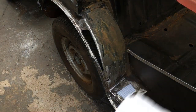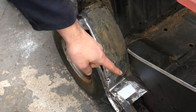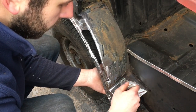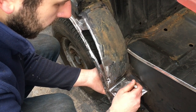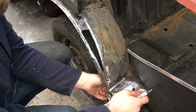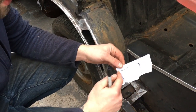There are obviously a few ways to cut it. You can buy yourself a set of tin snips, which you've seen me use a few times in this series, or you can use a disc cutter - but make sure everything's clamped down and safe. So like I mentioned, I've got some paper - you can use cardboard or paper. I've cut a little section out and placed it down here. I'm going to put my hand underneath and draw the best line I can around it. I did it that way and I'll make that out of steel.